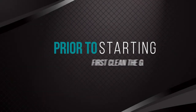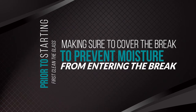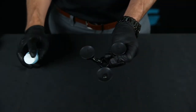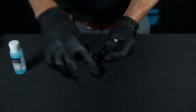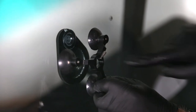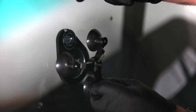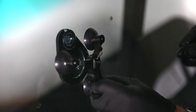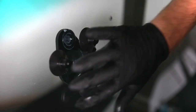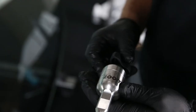Now that we've flexed and prepped the break, we're going to make sure the tripod has a small amount of lubricant on each suction cup — not much, just enough to make an adjustment once on the glass. Line the tripod up directly over the break in a Y-shape rather than a T-shape, because if you use an excessive amount of suction cup sealant you wouldn't want it to drip in and contaminate the break. Press each suction cup individually — don't press it with your hand, as that could lead to a suction cup not being fully adhered to the glass.